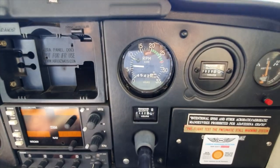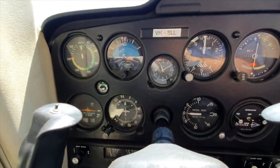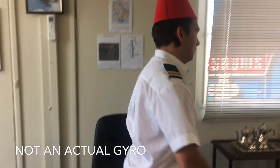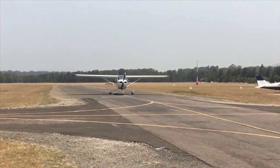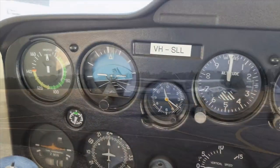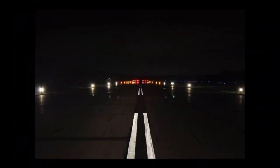This requires engine RPM. Consider the effect of going straight back to engine idle after the run-ups. The vacuum will be lost and the gyros will start to spin down. Let's imagine that we were about to enter the runway and take off night VFR or IFR with the gyros spun down and an inaccurate flight attitude indicator, especially on a dark night.